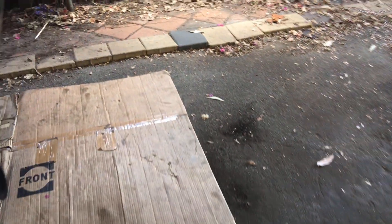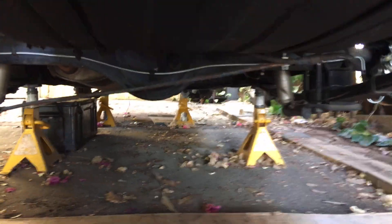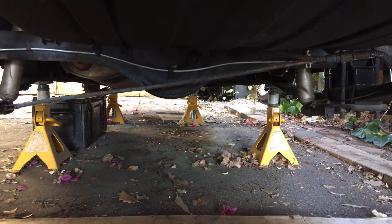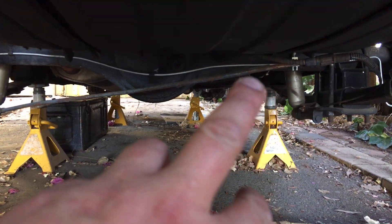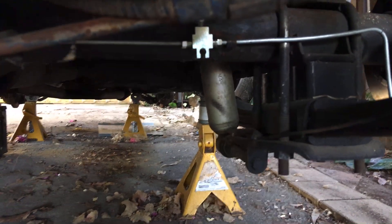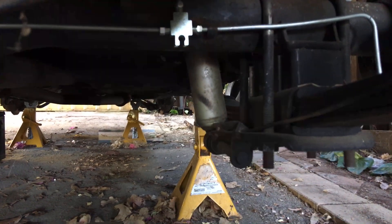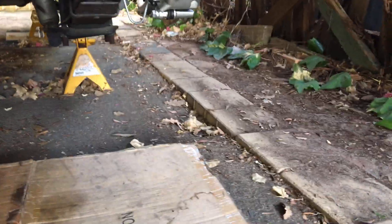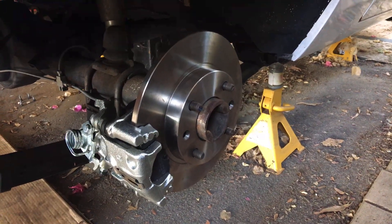Now I'm going to take you around so you can see the new brake pipe. All the old pipes are useless — you can't use them at all, you need to make new ones. Up under there is a T-piece, because with drum brakes one pipe goes into one side and then another pipe comes back across to the other side of the car. That's no good in this application — you need that T-piece to split the pipes. So it's not a really difficult job, but there is more to it than just unbolting one lot and bolting a new lot back on.